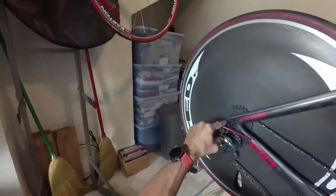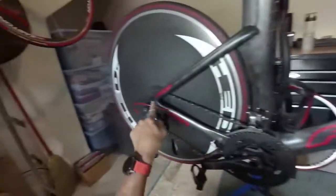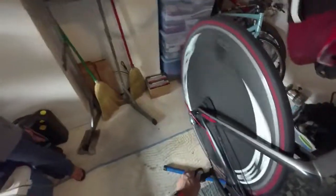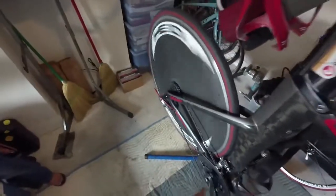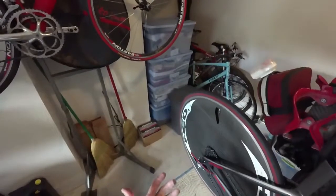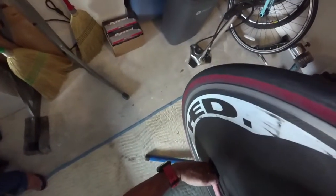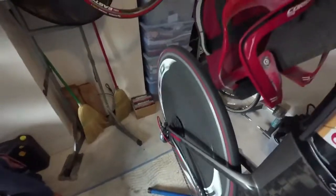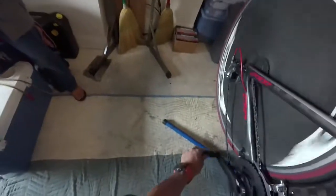So we need to go to the rear. On both bikes I always try to make less tension on the derailleur. You can see there is a lot of tension in the chain — a lot of people will stop and stay in this gear, or go to a light gear but still in the big chainring. Look how much tension there is; that's going to make my work really hard and there's no clearance between the derailleur and the wheel. So the first thing to do is shift to your small chainring.